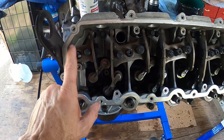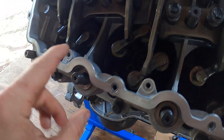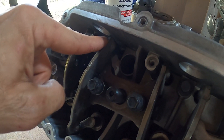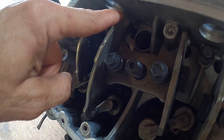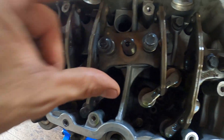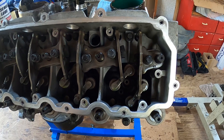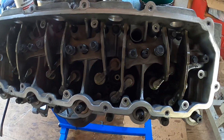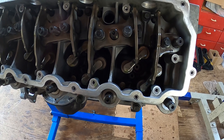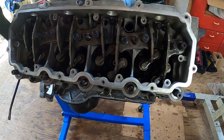I just took the rocker assemblies and sat them back in. I obviously put lube in between the friction point and between the top of the rocker arm and the push rods. They're all lined up but not tightened down yet — we need to do the head studs first. I need to get my ARP head studs, my washers, and my lube, lube all of that up, and then we can start torquing this head down.